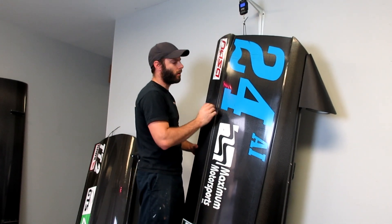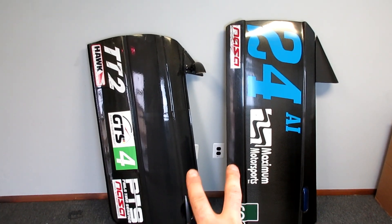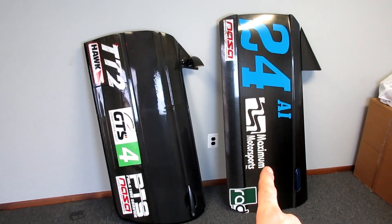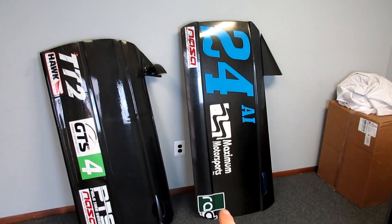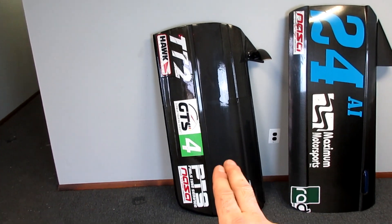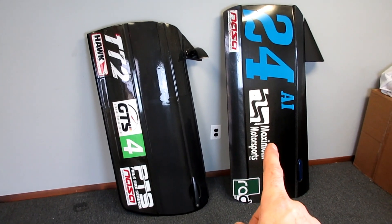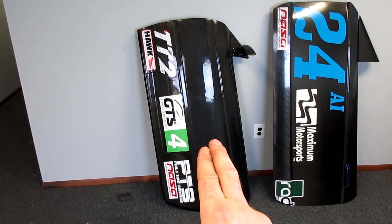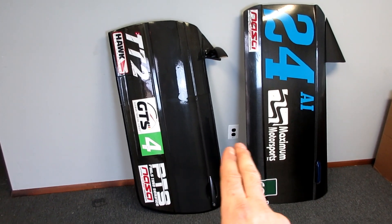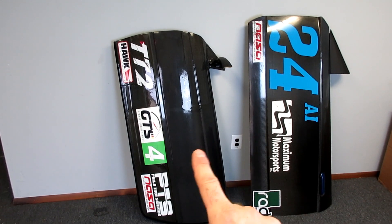You can see how much weight can be saved on a very similarly sized door. Two 'carbon fiber' doors: one made with better materials and a better process comes in at just over 10 pounds with all the hardware — the door itself stripped is about six pounds — versus one made with cheaper materials and a cheaper process, which comes in 70% heavier. There's not necessarily anything wrong with this technique, especially if price point is important to you. Just know that there's a difference between what is sold as carbon fiber between two different parts.